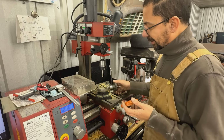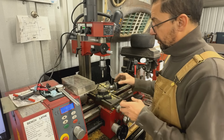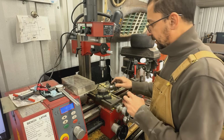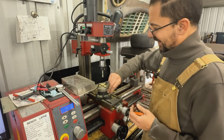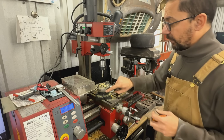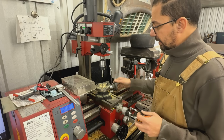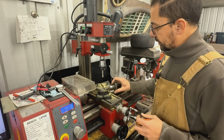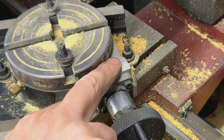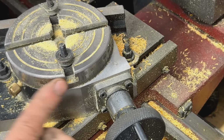And now, like how backlash works, because you see, the turntable has lots of backlash. So now I had to take in consideration the backlash all the time, tighten it here and all that. A funny fact, something that threw me off a lot in the beginning, I have scale here for the degrees, and I have scale here on the wheel as well. This is where the mark is, but I wasn't using this mark. I created my own mark here where the black line ends. That was my mark, so I could see.